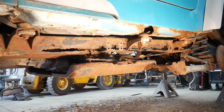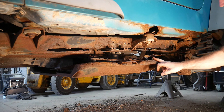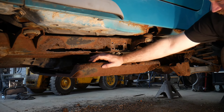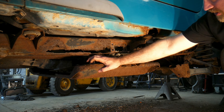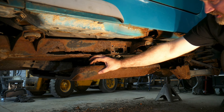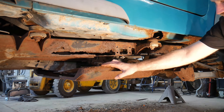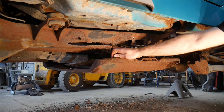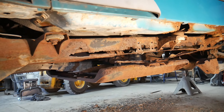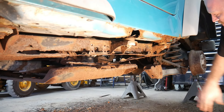Now with the center section you can see here are the bolts for the skid plate that's fallen out. The bolts use a rivnut type nut up inside the frame which, as they start to rust, will either break, strip out, or just spin. In this case the whole thing just kind of went to hell and just fell out. Really there's very little holding it except for this little strap here.